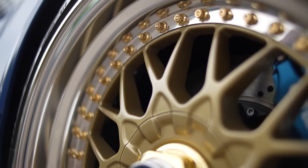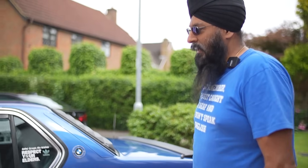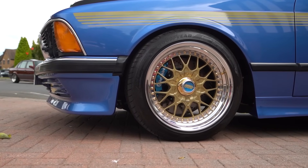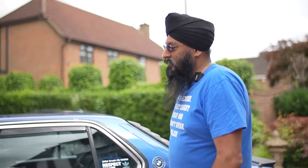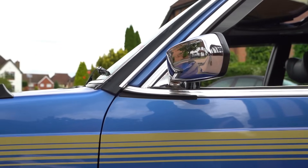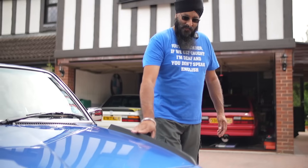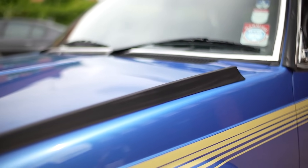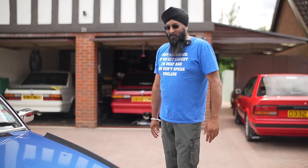One of the main things that no one does with these cars is big brakes — no one seems to do them. They come with four pots from the factory, but I wanted to go slightly different, so I commissioned a set of six-pot brakes up front with a 340mm disc that runs on a floating disc. Doesn't need it, because the car doesn't even go that quick, but it just looks nice when you look through the wheel. Then four pots on the back. These are Series 1 — not a lot of people will recognise those. The Series 1 E23 came with the chrome mirrors and I think because this car is chromed it really sets that off. These windbreakers are actually from an E9 — I got them through a company in the States called Island Engineering. They're stuck on so they can either come off or stay on, but I wanted something which looked a little bit retro.